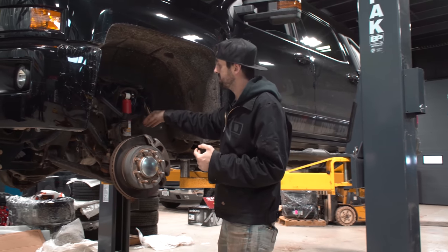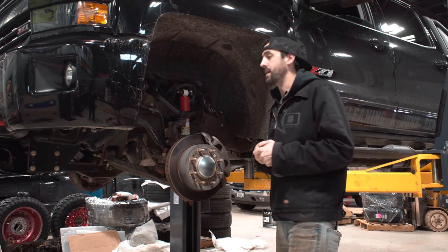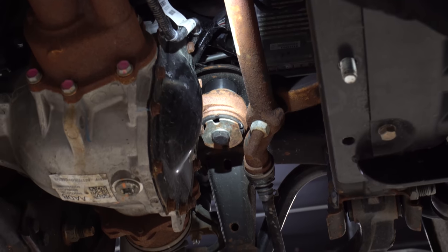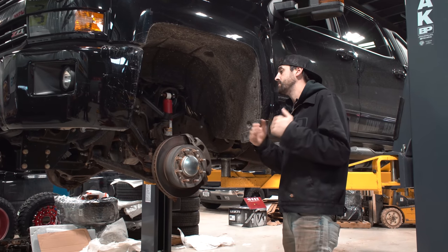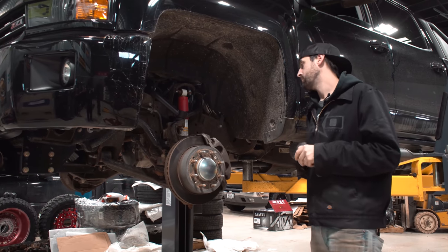You won't be able to see it, but there is a slight diff drop in there. Keaton will get some up-close shots — you might be able to see some of that. It's really hidden up inside of there, but that's gonna get those angles down and make everything work. This truck is equipped with a plow, so we're gonna end up having to crank those keys way up to offset that weight, and this is gonna keep all of the angles sitting where they need to be.